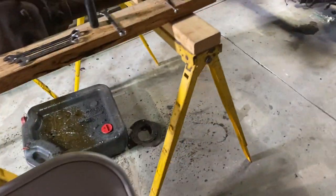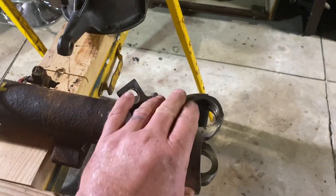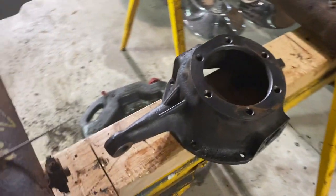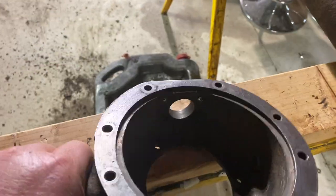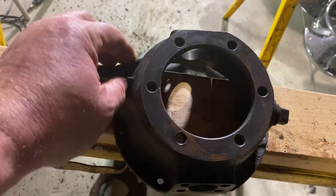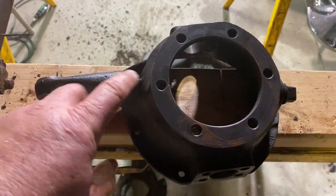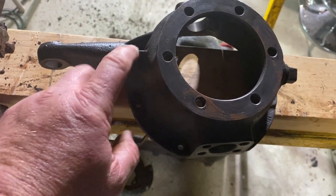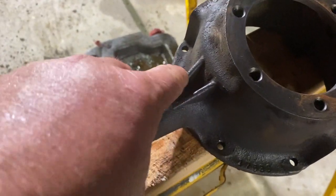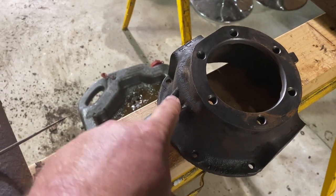I'll show you what it looks like once it's all done — I already broke this one down. There's your steering ball that your knuckle rides on, you have a small bearing here and one on the bottom. These are what your king pins ride in, and this is your actual steering knuckle. I cleaned this one up a bit and I'm going to have it sandblasted. These are not all the same — the 2A, 3A, 3B, all the way to CJ5s are all different. On this one you can see these two gussets — that's something they did later. The earlier models didn't have these two little reinforcement gussets, so this is a next-generation design.